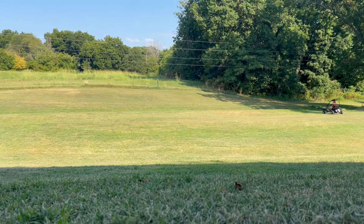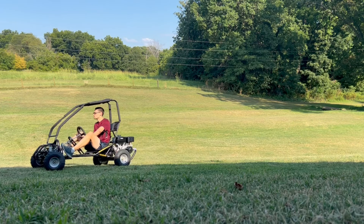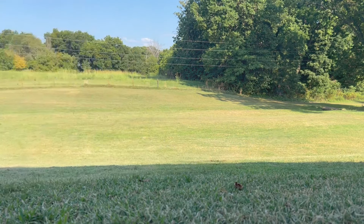The steering is very touchy, a little twitchy — especially over the bumps. I may do something in the future to try to change the gearing of that if it's possible. You really don't have very much steering feel at all because of the way they have it set up with the gearing. Build quality seems pretty solid. The only issues we've had: one of the frames did break — used some glue and may weld that in the future, but the metal is pretty thin. That might be something I consider building myself out of some tubing someday. On the kids' carts, the kill switch wiring broke because the kill switch is mounted on the steering wheel instead of on the center column piece, so there's some stress put on those wires. I plan on re-soldering and lengthening those in the future. But the main body of the cart and the engines seem really solid, even as bumpy as we've been driving them.